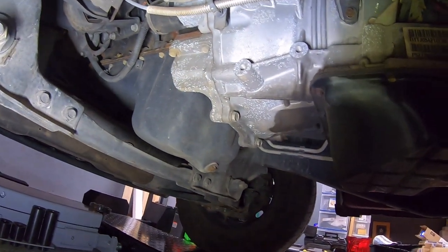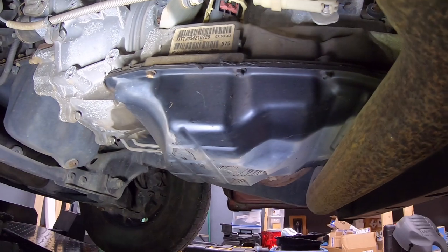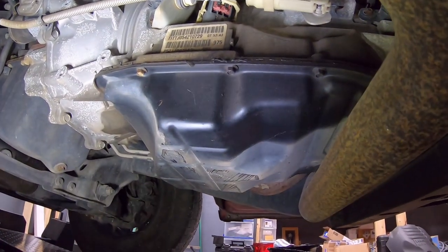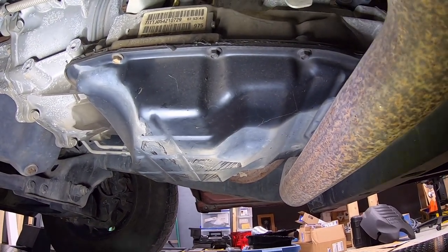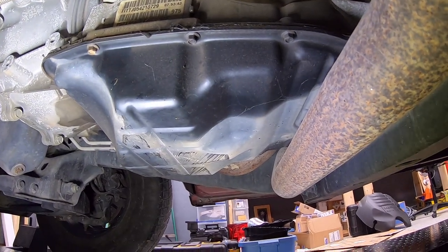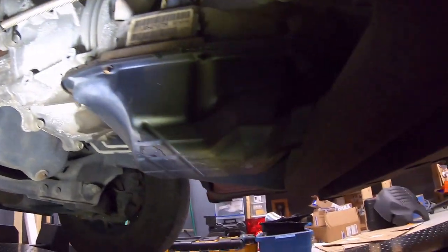Here are some shots of the motor. We've got some stereotypical transmission pan leaks, but if you've got a Dodge Ram of any kind, transmission pan leaks are pretty much normal. We had one in the 09, I've had one on my 2500 with less than 20,000 miles. If we continue forward, we'll do a complete transmission service and upgrade to the same deeper, thicker pan for better cooling — especially since the end goal is a built-up supercharged 5.7 Hemi.